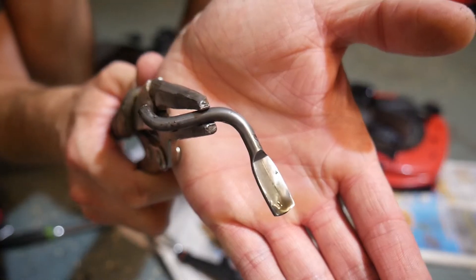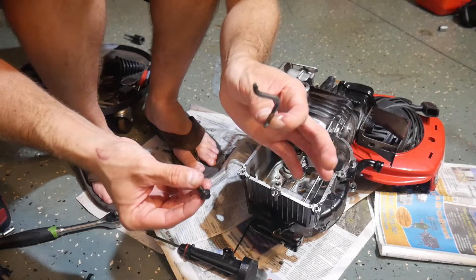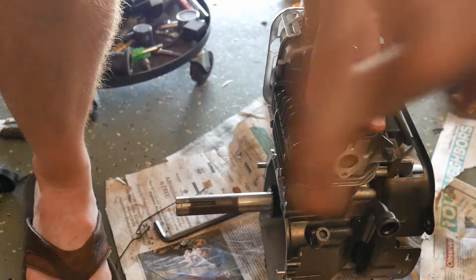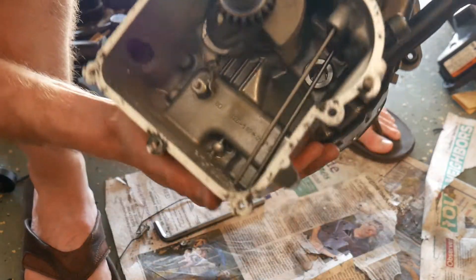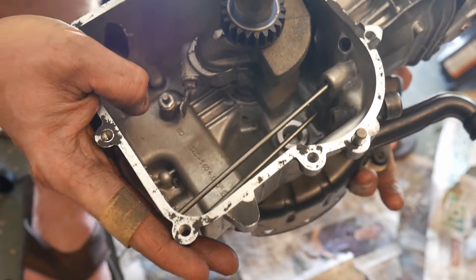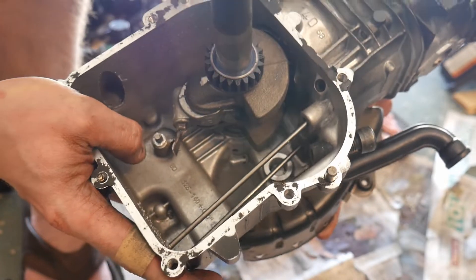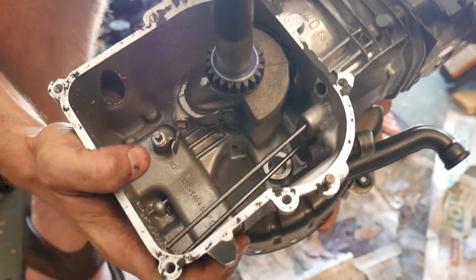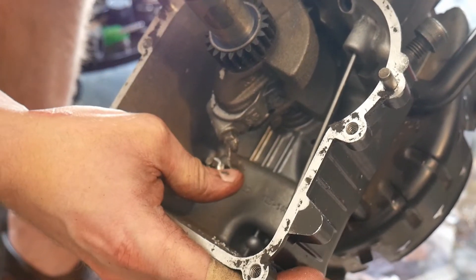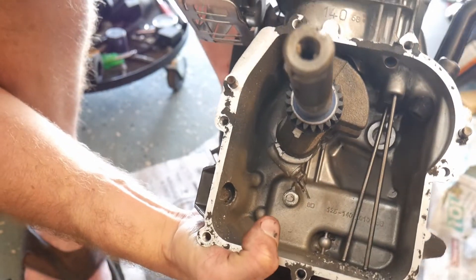Alright, let's get to chopping — safety third. This is the little governor piece. What I'm going to do is weld this little bit onto that bolt just like that. I've now ground down a lot of this little peg — that's as much as I'm comfortable grinding without cutting all the way through it — and then I just nipped the end off of our little plunger here.